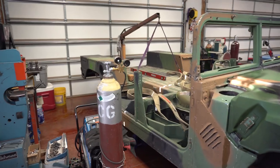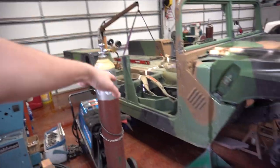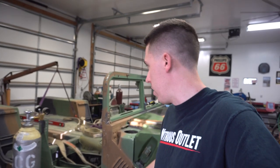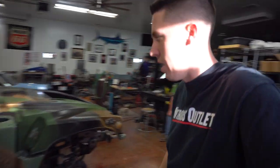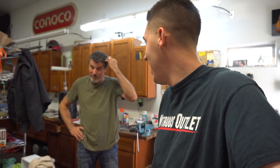In a sense it's LS swapped — it has an LS in it, just needs to actually run. It fits; sinking the body over the frame rail and everything else coming in is not too bad. Stub the front, finish off the back, and you'll have pretty much a roller other than suspension. That'll be it for this one. The body's on it, he's going to work on fabbing up the front and body mounts, and then on to the next thing. We're now talking about all the big parts orders — headers, EFI, fuel pump, fuel system — and figuring out what power adder we're going to put on this thing. The fun part really begins. If you want to see more of this Hummer build, make sure you hit that subscribe button.